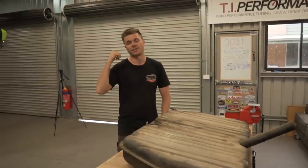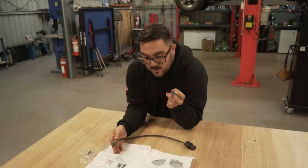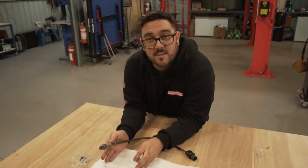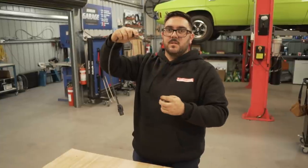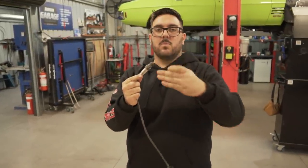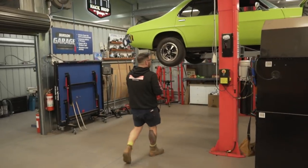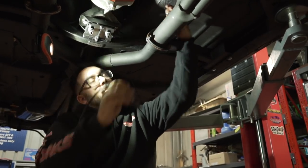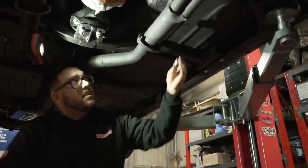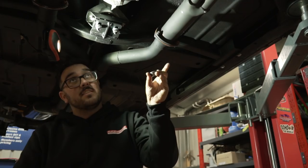So what we're going to do now is get started on putting the bung into the exhaust - into the extractors - for the O2 sensor on the Holley. The instructions ask for 10 degrees above centreline because O2 sensors don't like moisture and prefer to be higher rather than low where water could potentially sit. We'll mark this on the extractor, rip the extractor off, weld the bung on, and put it back in. We want it angled upward towards the gearbox so we can run our wiring up along the back of the gearbox and up to the back of the car. Thank god this is the easy side - let's drop the extractor and weld this in.